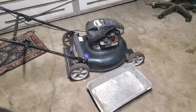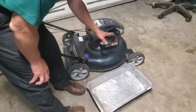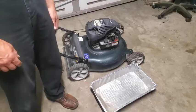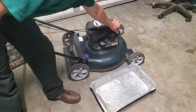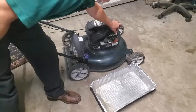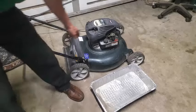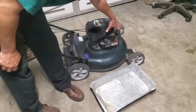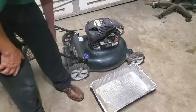I am choosing to go for the quick fix on this one. I'm going to dump out whatever is in the gas tank — I'm thinking it's a lot of water. And then I'm going to extend this spring out so there's not so much spring tension. I just extended that, maybe about a quarter inch, and that's going to affect the RPM on this thing as the governor is going back and forth.